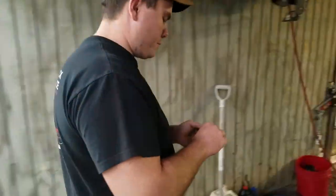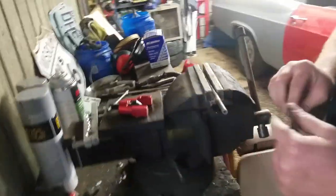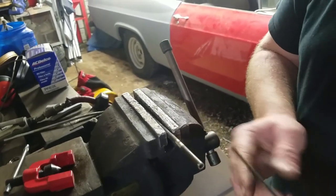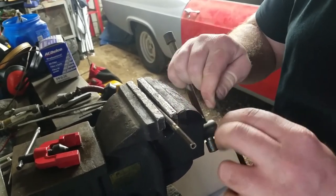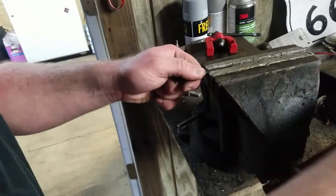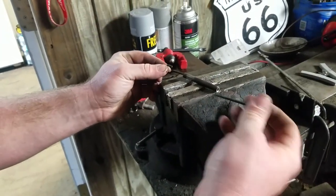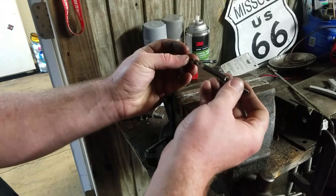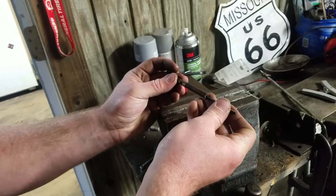Because we're slightly shade tree mechanics around here, I've got an old push rod. I'm going to cut it off, cut a sleeve out, slide this in, cut this in half, then slide it in, weld it on one end, and then weld the threaded end on so we can still adjust it on this side. Got the push rod cut down. Put one side in here, weld it, put this side in here, check it on the truck, see how long it needs to be, and then weld it so we can lengthen it to however long it needs to be to make it work on the truck.